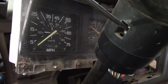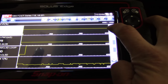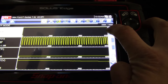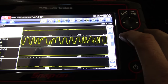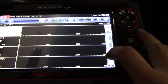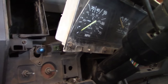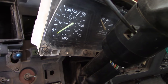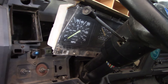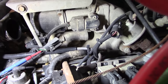The idle is already lower than it was yesterday. I just went into closed loop. Oxygen sensors are switching. It seems like the intake air temperature sensor is working as well - it's up to 55. It's really not any better though - still about 1400 RPM. The IAC is completely unplugged right now, the idle air control. So I think that's where we're headed next. I thought we were onto something with that coolant temperature sensor, but it doesn't seem to be really any better.